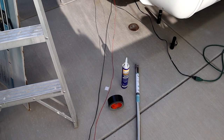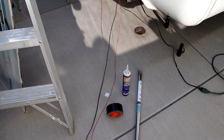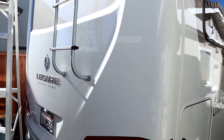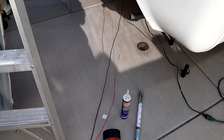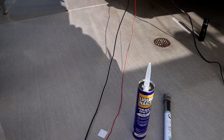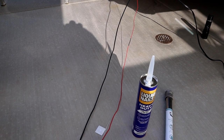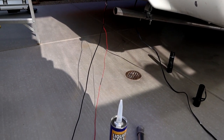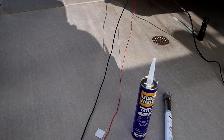Now I have the hole at the top. I have a wire fished down through and connected to the video cable. I don't want it bouncing around in the back area, so I'm going to try to attach it securely to the fiberglass wall inside. You might notice my red cable is long — that's because I spliced another 20-gauge wire to it so it would feed to the bottom of the cowling on the underside. That way, if someone in the future really wants those backup grids, they don't have to redo everything — they just need to hook to that wire.